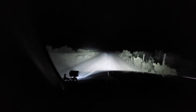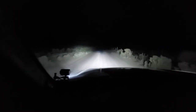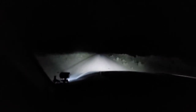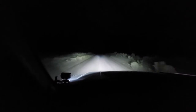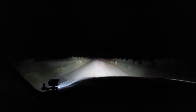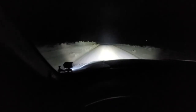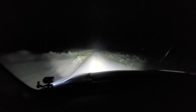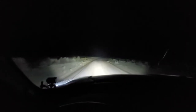The big light bars up front are designed to give us distance lighting down the road. The high beams on this truck actually still don't work properly — I started having that issue as soon as I installed the HID kit, which is part of why I'm switching back to LEDs. I think the HID kit is putting too much draw on the passenger-side headlamp circuit, so there's not enough current to power that high beam bulb properly. Now I'm going to turn on the main Lightronic white bars mounted up front — and it's a pretty amazing difference. There's some splashback and light in the air because I turned around and there's dust kicked up.